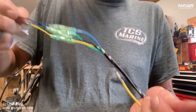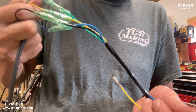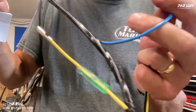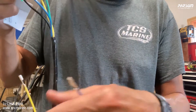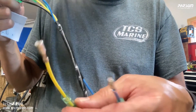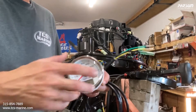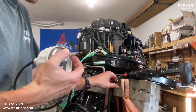The black wire is ground, the blue wire is the light. These two are pickups for the tach. You have two other wires coming off of this — this is going to be your light and this is key power. So one key power for your light and this one is to run other stuff. Here's the tach complete.